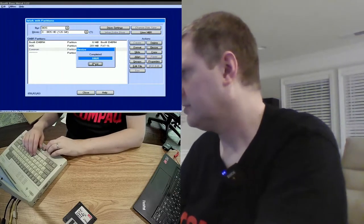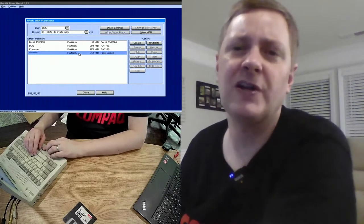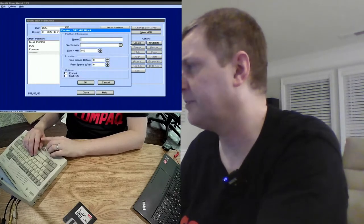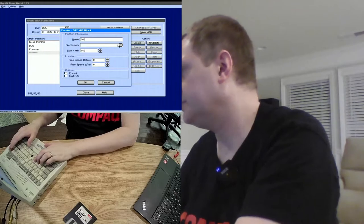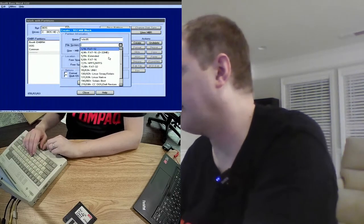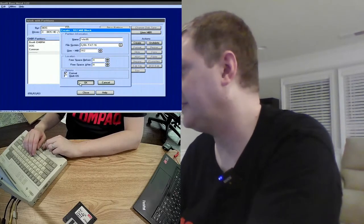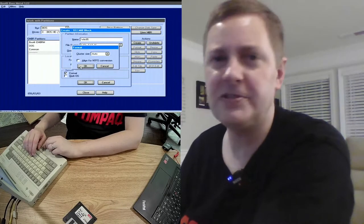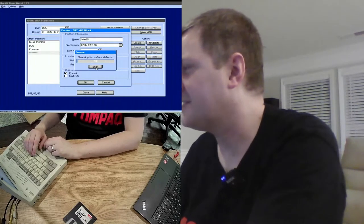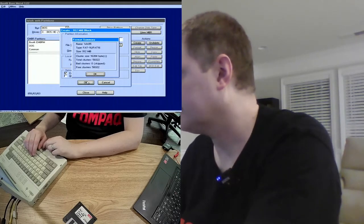Complete. So now what I can do is create a Windows 95 partition. Since it's only a 900 megabyte drive, I'm just going to do FAT16, and there's a very good reason for that. I can then use networking and MS-DOS or Win 3.11 to copy over the installer for 95 without having to use FastLynx or something else. And that's typically how I do this. For the 13 plus machines that I've set up, I've done it all the same. I guess consistency is a virtue, or boring, but that's how I've been setting these puppies up.